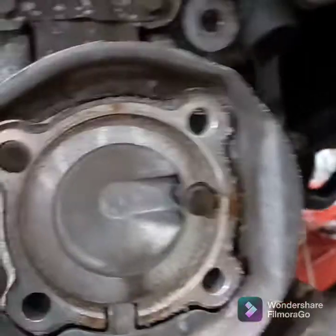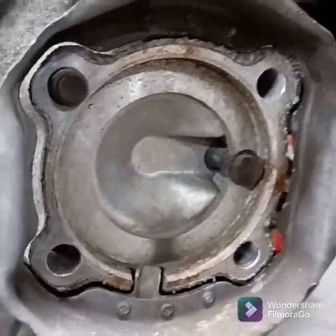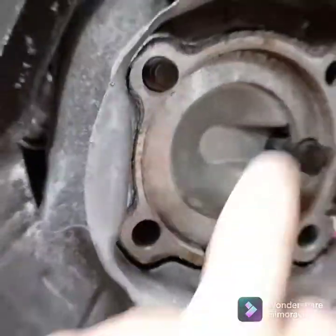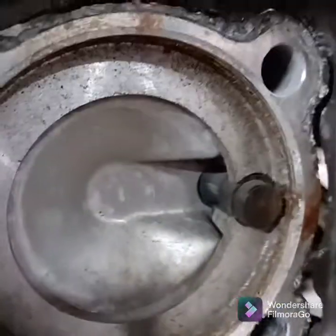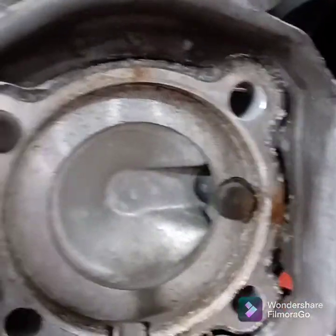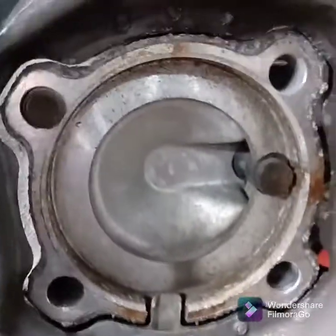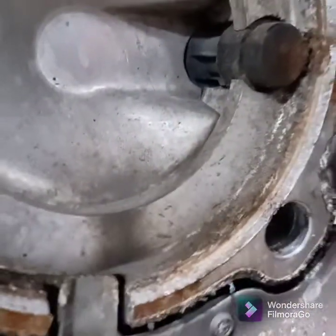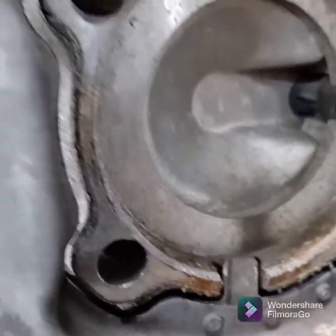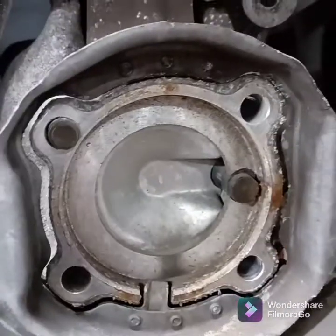When you're back there, loosening the bolts, just be careful not to break the connector off, the harness off the other side. This is probably corroded in place anyways, so to remove this, you'd probably end up pulling this and punching it through with a hammer and chisel, or a hammer and a punch anyways, so I'll just try not to disturb it. I'm just going to clean this up a little bit. It's not too bad, but I'm just going to get in here with a little scraper, clean that up, and put some anti-seize on it, and just reverse procedures, put the bolts back in, and actually have new bolts.